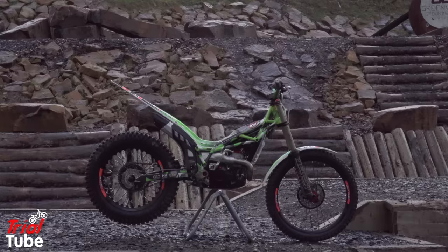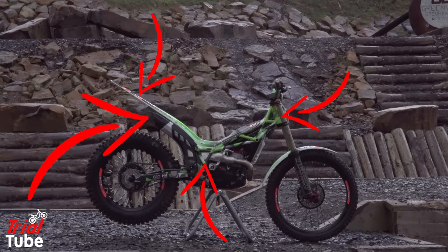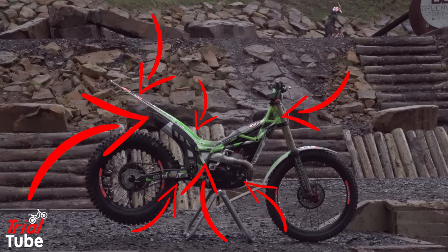So let's get started — we're going to be talking about the changes first and foremost. New frame, slightly revised head angle, same wheels as the R3. Also that brand new exhaust, that mudguard housing unit for the new ECU to supposedly keep it dry, new linkage, new water pump which is still electrically driven, and a few other little plastic parts to just tidy her up.